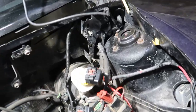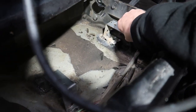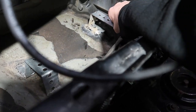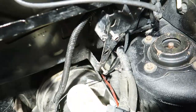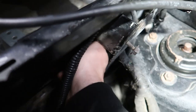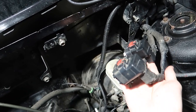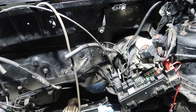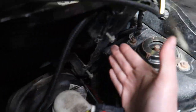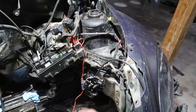After some measuring and calculating, I think I'm onto something actually pretty cool. As you can see, we have our PCM mount kind of in there. I got to clean up the welds a little bit, but not bad for a kid who doesn't know what he's doing. That's going to be a perfect spot for the PCM to sit. I did some measuring and it looks like if I make a grommet hole down in here, I'll be able to fit the PCM connectors through it and I don't think I'll have to extend at least these two at all. It looks like everything will fit right up through here directly with plenty of space to hook into the PCM and be all tucked away.